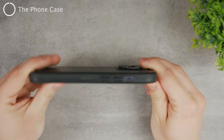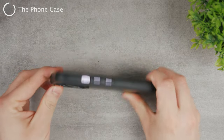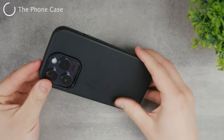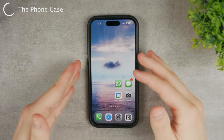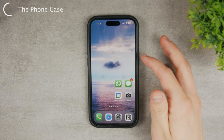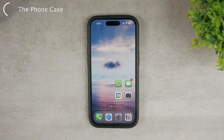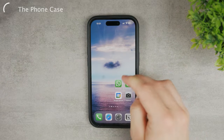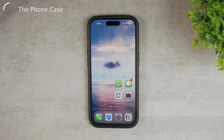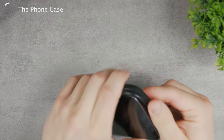First of all is the case. If you have a thick case like I do, it may actually stand in the way, believe it or not. This is not even the original Apple case — those are made from a material that shouldn't disrupt the signal. But if you have a random third-party case, it may actually block the reception. So at least just try taking the case off to see if you have better signal.